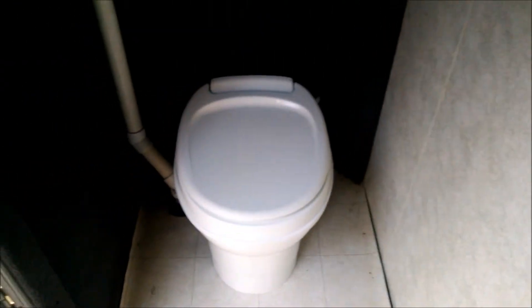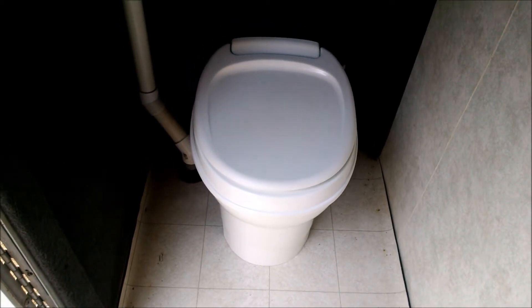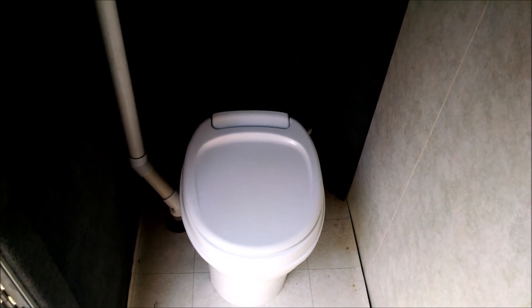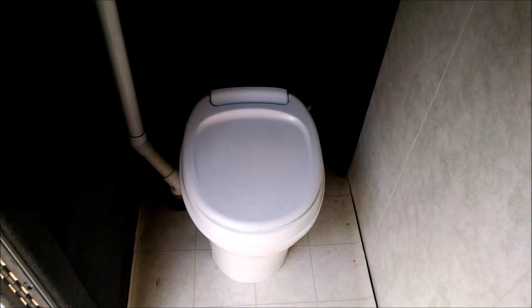We put a Thetford-style RV toilet in the back of the closet. We had to think about this — our first thought was it's a closet in the back of an airport shuttle, kind of cramped. But we started measuring and realized this is actually a 30-by-93-inch closet, and most RV bathrooms are about that size or even smaller. We also measured bathroom stalls — this is actually plenty wide. What I want to show you is we completed the vent today. We came up through the floor with the vent out of the black water tank — this is an inch-and-a-half PVC.